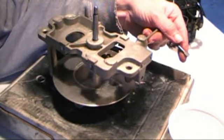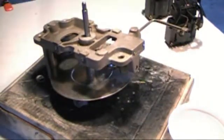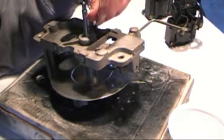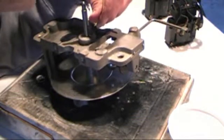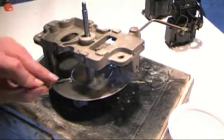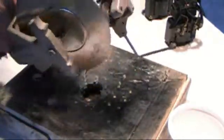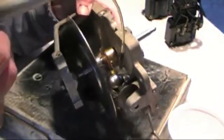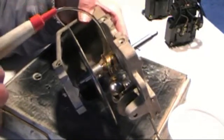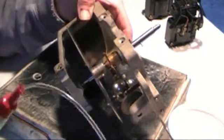That's perfect. I'm going to go ahead and put some lubrication down the spindle shaft. I smeared it with grease before I put it in. And I want a little drop on the friction pad — the leather on the friction pad for the governor, which is right here. I'll go ahead and put a drop on the governor, the center part of the governor there.